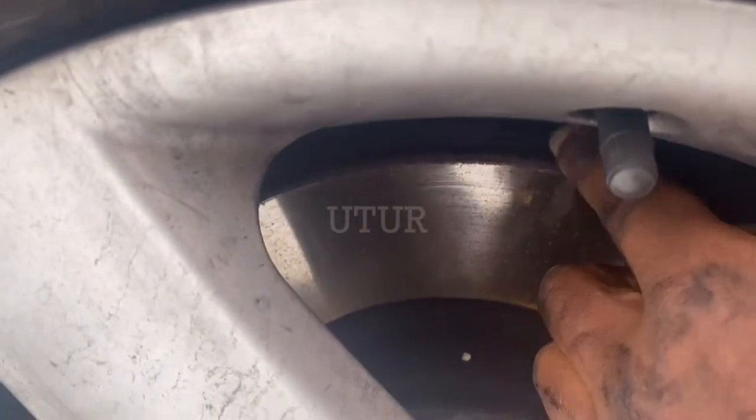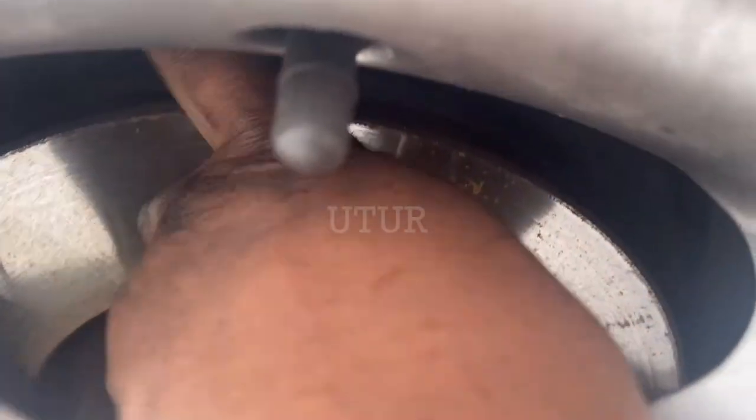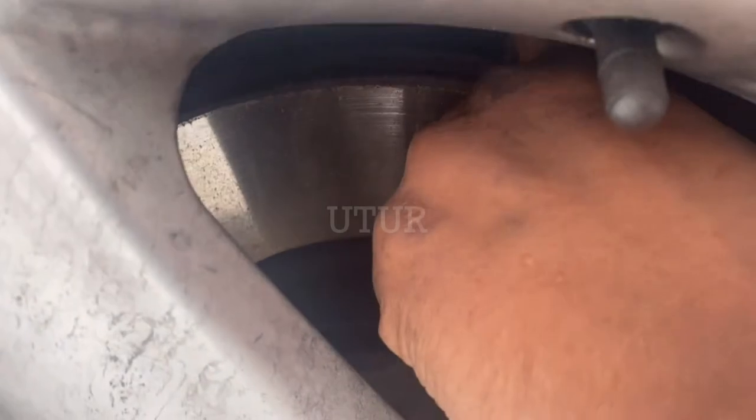Before taking the wheels off I also looked out for other defects like grooves, visible cracks, and hot spots due to uneven brake pad deposits, which can lead to brake harshness and vibration that may compromise structural integrity. I also inspected for corrosive rust — what we've got here is just surface rust, which should wipe off if we take it for a drive or heat the brakes. As long as you don't leave your vehicle sat for protracted periods without driving, you shouldn't worry about corrosive rust arising from harsh weather conditions and road salt.